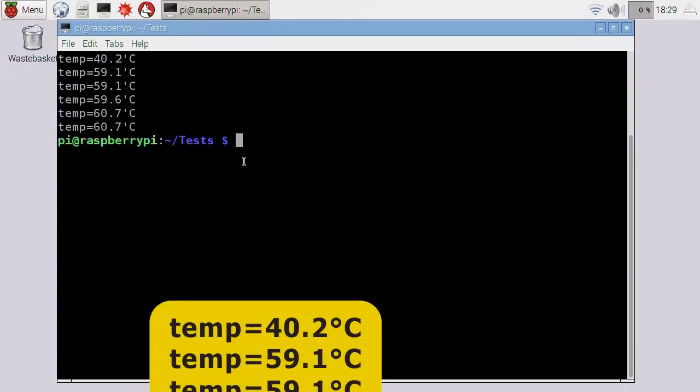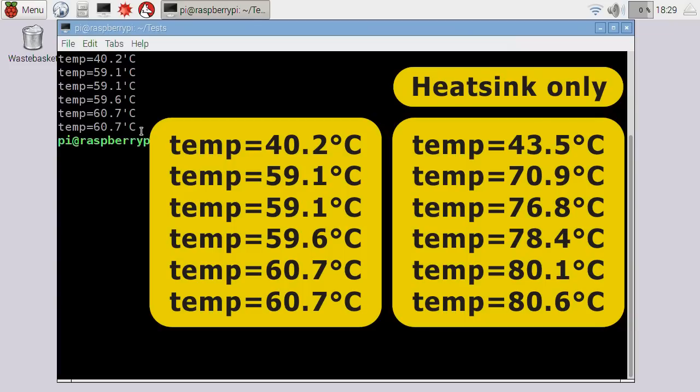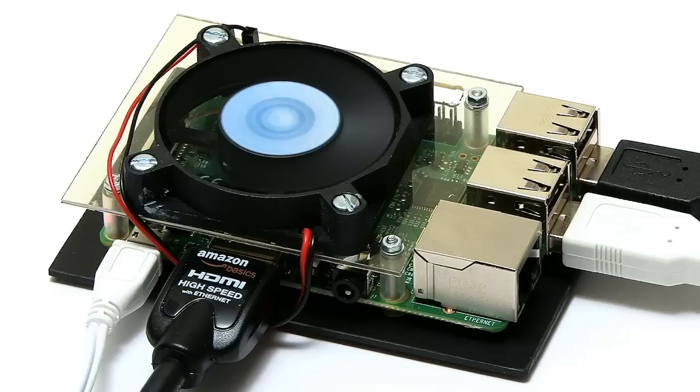And there we are at the end of the test — another pleasing set of results. The Pi has managed to keep itself just about below 60 degrees centigrade, and 60.7 isn't bad. The Pi is a good 20 degrees cooler than it was when we had the same heatsink but no fan, and I'd certainly be quite happy to run a Pi at around 60 degrees centigrade. I certainly wasn't happy to run a Pi at around 80 degrees centigrade. Although I'd stress again, if you aren't stressing your Pi out with this really hard processor test, most Pis will not need a fan or a heatsink. But if you are going to do these extreme things with them, you certainly do.